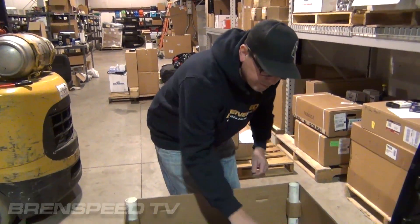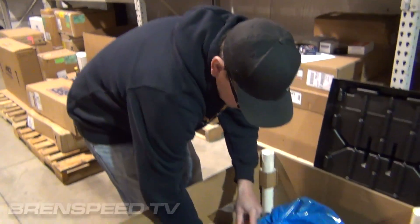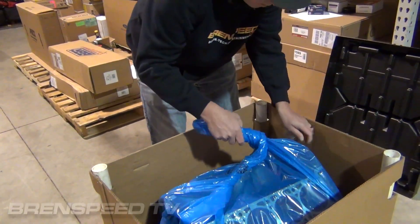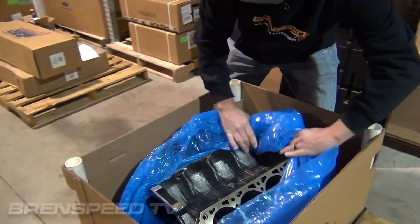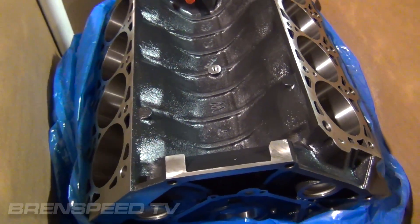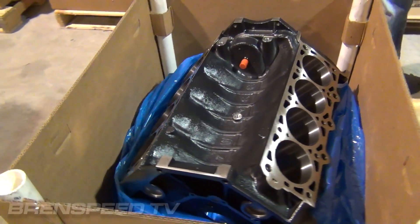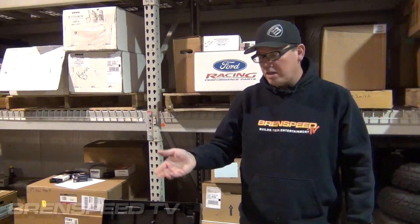Let's look down inside here. When you open it up, you're going to have this little bag right here — these are some dowels. You're going to need these when you put the cylinder heads on the engine. They come painted, and everything is always really clean. This is how they come when we buy them. From here we do some machine work to the block. First thing that happens is we put in some ARP main studs before it gets the machine work. When the machine work's done, it goes into our engine room — which we also call our clean room.